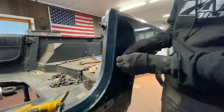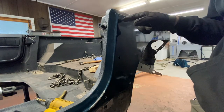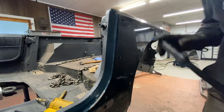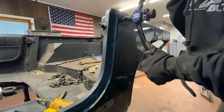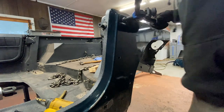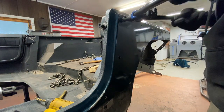It's looking like the half inch is just a hair too small — it's probably the next size up — but I don't have the next size up so I just took the half inch and kind of wallowed it out until the nutsert just fit in there, then put it in the body and bring the handles together. These nutserts are not easy.